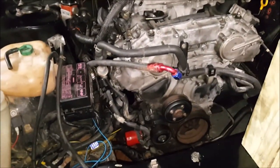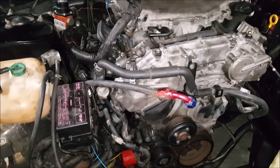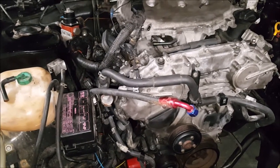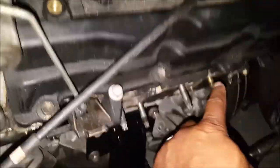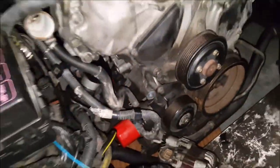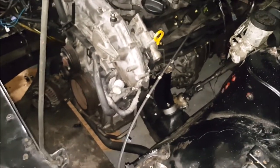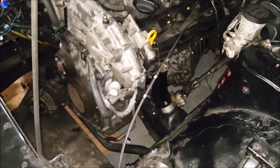The whole thing we're doing — I don't know if you guys have seen the SOHO kit for the 350s — but basically it uses stock exhaust. Now the stock exhausts don't work here because they hit the firewall in the back. You can trim and cut it, but what I was gonna do was flip them. This side comes out here, and the other one I'd have to do some short cutting because the alternator is here. But I don't want to run short headers because that doesn't help the motor breathe.